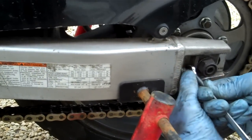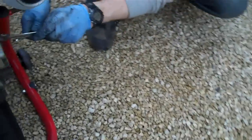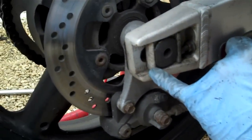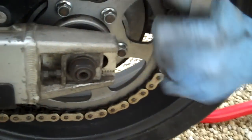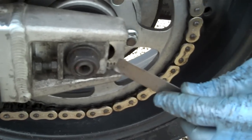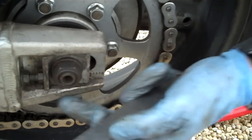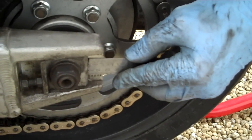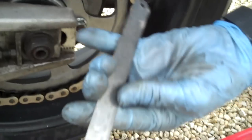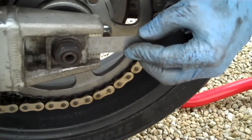That feels a fair bit tight enough. Just do up the lock nut gently because we're not going to torque it off yet. Then you've got to go around the other side and get it even. On the other side it's almost up against the big mark, so we're going to come back a little bit with the 10mm. These little punch marks in the swing arm are quite accurate, believe it or not. On a Bandit — many bikes have got this kind of carrier block and slide on the swing arm — you just want the distance the same either side, which means the wheel is then facing exactly forward.